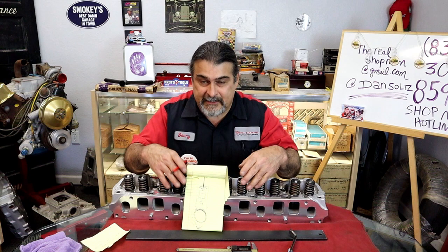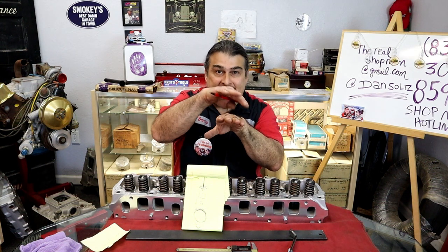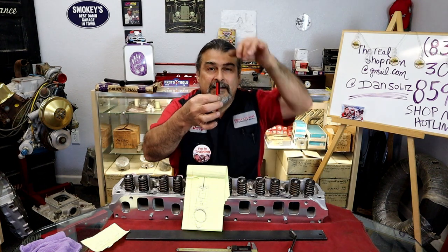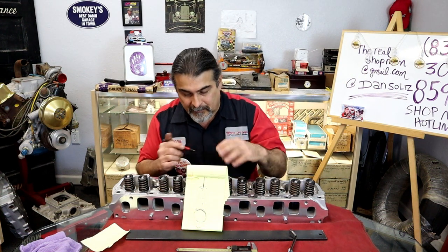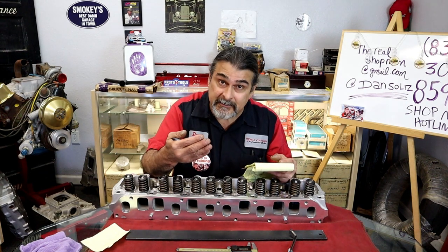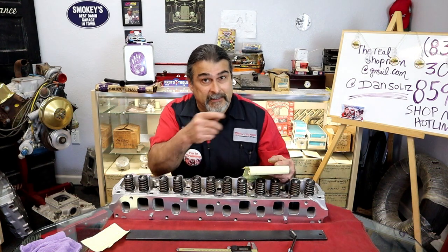So the easiest way is to move the cam lobe down and you're at the base circle. The lifter's there, the push rod's there, you're spinning it with your hand and you're tightening the nut until it just touches. Zero lash or no clearance. Okay, if this was a solid, we would have lash and clearance. We would have a feeler gauge there and we would have a gap. No gap. Remember Smokey, no gap.